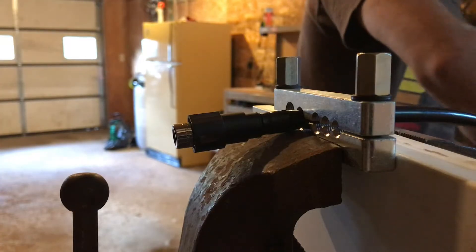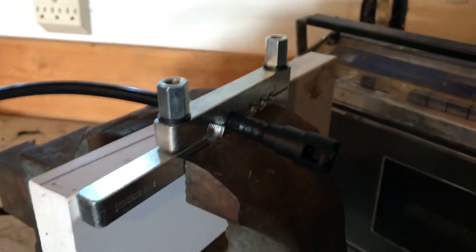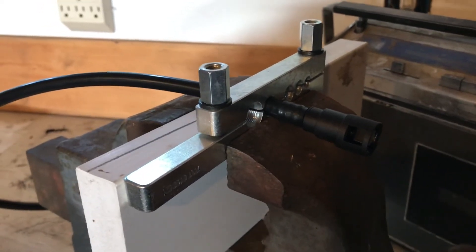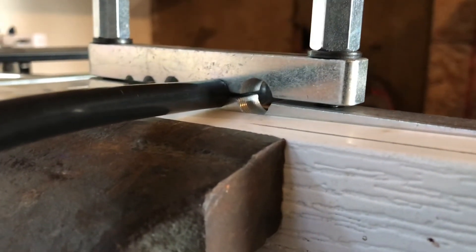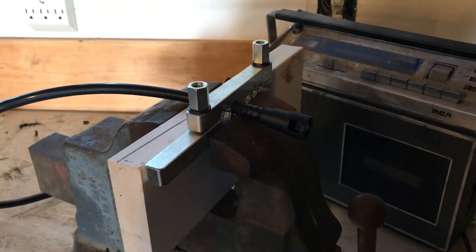And there you have it — second fitting installed, nice and flush, everything went good. I probably only used the hair dryer for 10-15 seconds; you don't want to get too carried away with the heat because you'll just kink or mangle your hose. The inside of this clamp has almost like threads in it, so you will see a little bit of scoring on the tubing, but nothing major — just as long as you don't collapse the hose. I had this tightened down finger-tight, snug, and once you warm it up everything goes smooth. Appreciate you watching, hope this helped, and like, comment, and subscribe if you would — thanks.